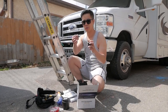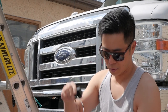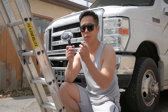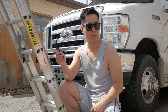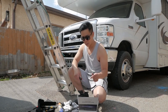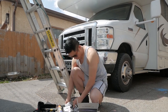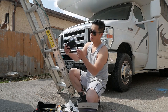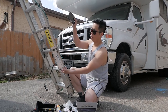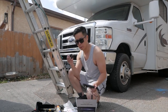I'm gonna show you the camera first. This little module here has a built-in antenna wire and built-in power cable. I'm gonna tuck it in the RV. Here is a power cable for the light — I'm gonna steal the power from one of the running lights, so when you turn the light on the camera goes on. Inside the car it comes with a cigarette power adapter with an on/off switch which you plug into the monitor. Simple: cigarette lighter on, lights on, and the camera turns on.